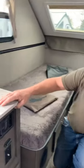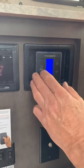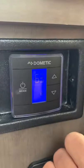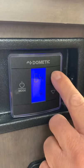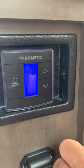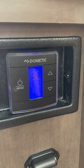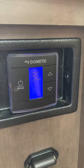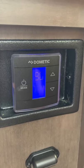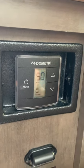This is the controls for the heating and cooling. The second mode — cool — is going to be the air conditioner; your temperatures go up and down. Then furnace with the heat-wave icon. Heat pump runs the reverse sequence on the air conditioner. The heat pump only works down to 40 degrees, so if it's colder than that you must use the furnace. The heat pump only runs on 110 — it does not run on battery or LP gas.